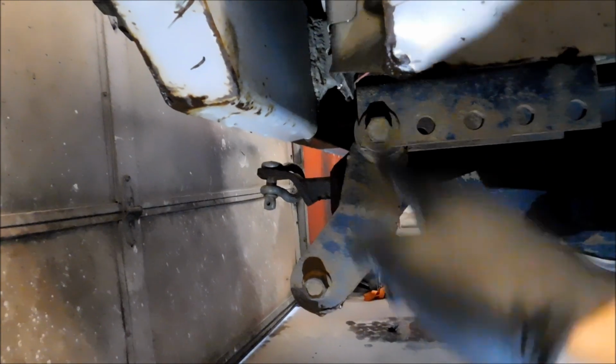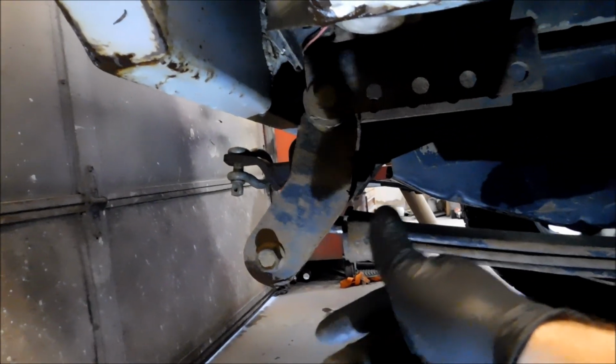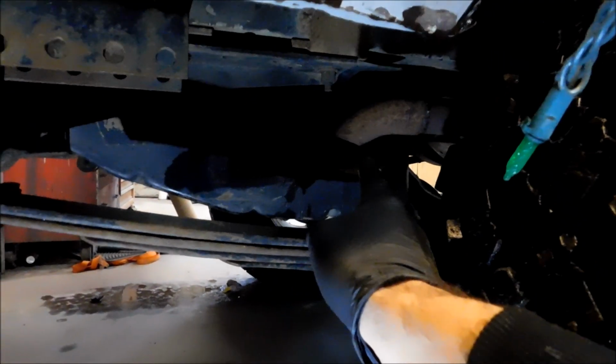So I had it just lopped off straight back here, but with the trailer and the flat fascia of my rear bumper, where that exhaust was, it was creating a pocket back here, and it was creating a lot of turbulence, and we were getting exhaust smell inside the cabin, even with it real close to the exit.